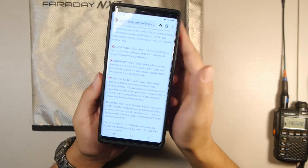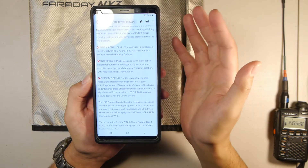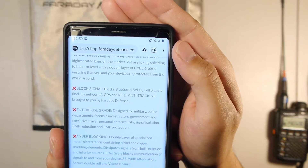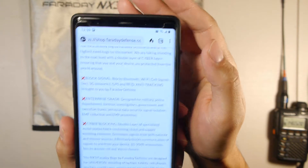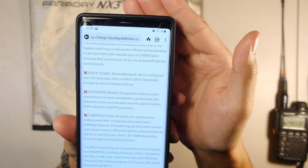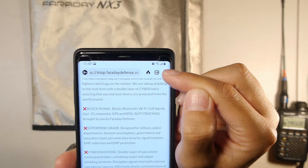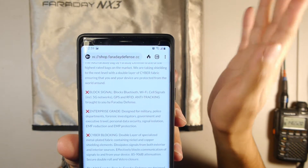This cell phone operates on a 700 MHz to 900 MHz band. The transceiver inside is also receiving 2.4 GHz bandwidth information, so it is a dual-band type of radio inside your phone. We can tell that signals are coming from both our router and the cell phone signal, so we know it is operating on both the UHF and super-high-frequency bands.